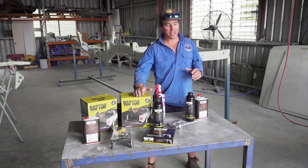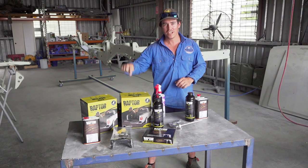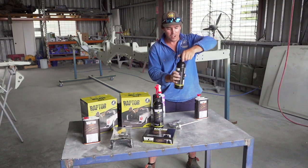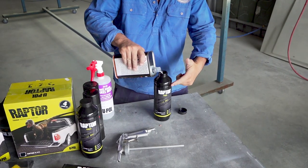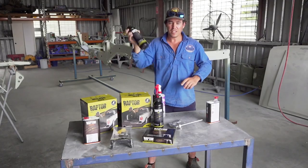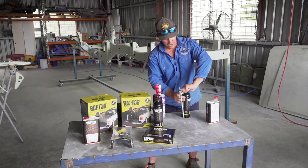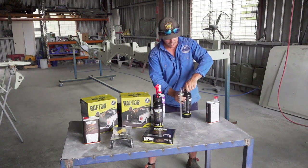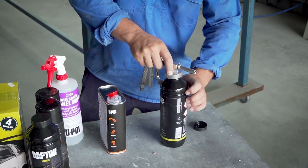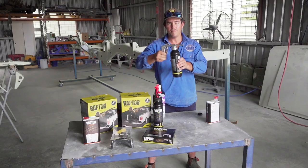When you're ready to spray Raptor it really is quite a simple process — simply follow exactly what the box says: fill, shake, and shoot. The first thing we're going to do is fill up the Raptor with the hardener. There's actually a line on the side of this Raptor liner bottle that you want to fill it up to. Give that a shake for about two minutes. Then grab yourself the Raptor applicator spray gun, which simply screws straight onto the bottle. This has been specially designed to shoot Raptor lining very easily — connect some air and you're ready to go.